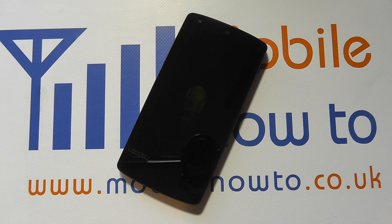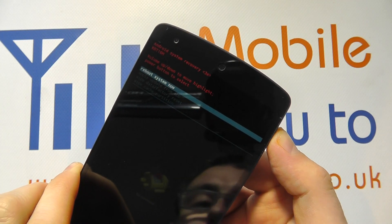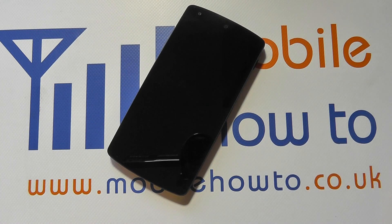Once that has been completed, you'll be taken back to a small menu. The first option already selected will be to reboot the device — press the power button once. We can see on screen 'Reboot System Now' — press the power button once and the device will reboot. After a couple of minutes we'll be at the original boot-up screen as if the Nexus 5 was brand new out of the box, and you'll have to reconfigure all of your settings. And that's how you factory reset a Google Nexus 5.